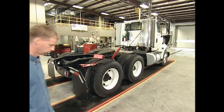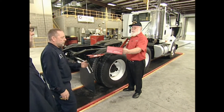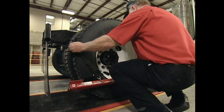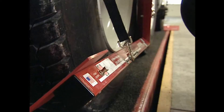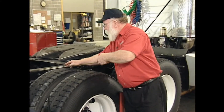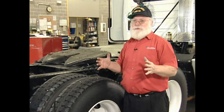Now we're going to move around to the other side. We've got the laser set up on the other side shooting to the front. Put the other laser against the steer tire with a zero measurement, then put it against the drive tire — strap over the top at nine o'clock and three o'clock, bottom of the bar at the bottom of the rim, front of the bar at the front of the rim. Turn the laser on and tilt it up or down until the laser hits the target. On this side we've got three and a half inches. Now we check off-center: 31 and three-quarter inches on this side too. So this axle is in the center. That side laser measured three inches, this side measures three and a half — so this axle is going to the right a half inch in the length of the truck, which is right where we'd like it. It pushes the truck to the left.